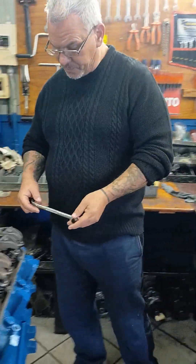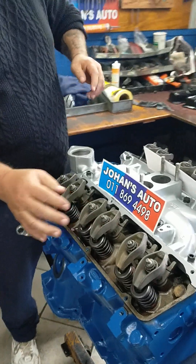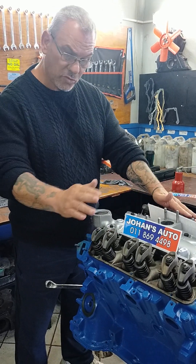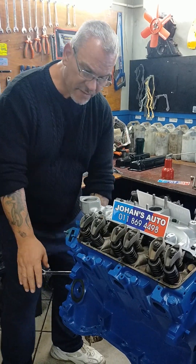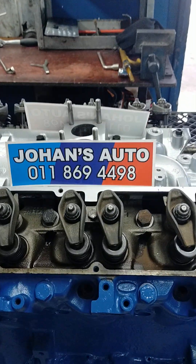What you're going to do first — and a lot of people ask me when I tell them to rock 5 — when you stand in front of the motor, you've got six cylinders. Your firing order will be 1, 4, 2, 5, 3, 6. Number one is here, so we're going to rock 5. I'm going to show you how to do that.